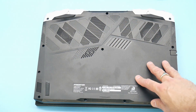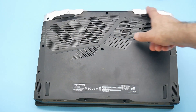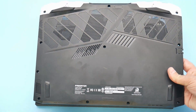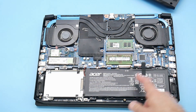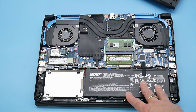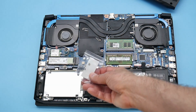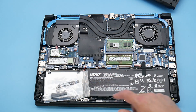The back cover is similar to before — it's still ABS plastic, but the heatsink shrouds have changed from black to silver this time. I do prefer the black from the previous model, and they have also increased the air intakes compared to before. You still get the same 59 watt-hour battery, which gave me three to four hours of run time streaming YouTube at 40% brightness. There is a hard drive bay and they supply the necessary tools, screws, and SATA cable — suitable for 7mm drives.